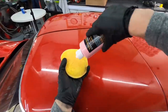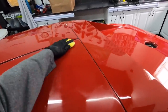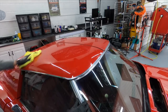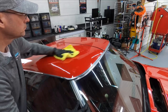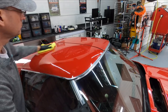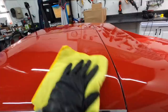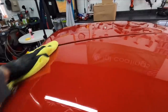LVR-357 gives a deep, rich, wet look to both clear coat and single stage. When it cures in 24 to 48 hours, it will protect against corrosion, oxidation, UVA, UVB, and surface contaminants — and gives the surface an incredible gloss that increases more as it cures. Give it that proper cure time. The product is at its best when applied standalone to clean, naked clear coat, but it can also be used as a topper on top of an existing coating, sealant, or form of protection. The durability just will not be guaranteed on top of something else compared to when it's applied to naked clear coat.